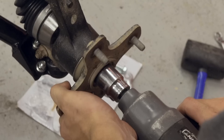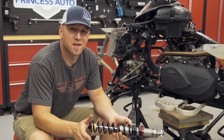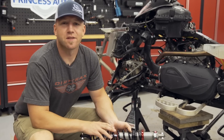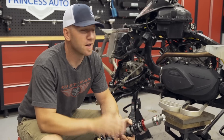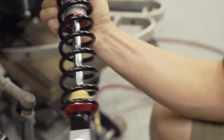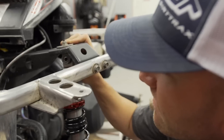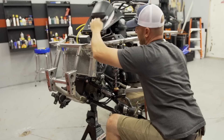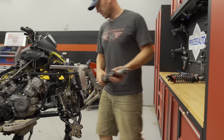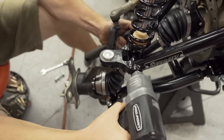In the way of suspension, I wanted to change out the 8,000 mile stockers because they were completely beat. Keeping in mind that I'm building a 2008 Gen 1 and not a 2017 Gen 2, I wanted to use shocks that would give me all the performance I'm looking for and none of the extras I don't need. I called Elka to find out what they recommended. I suggested using Stage 1s all the way around, but I'm glad I spoke with them as their sponsored mud racers like using Stage 2s in the rear and Stage 1 up front. These are hand built and shock dyno tested to verify they're built properly, and surprisingly they are very reasonably priced, coming in cheaper than what you'd probably pay for a new stock shock setup from the dealership.